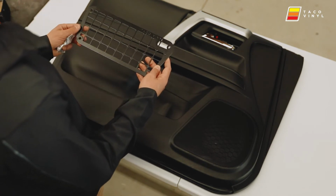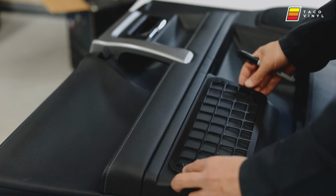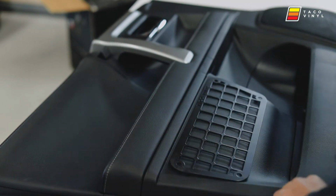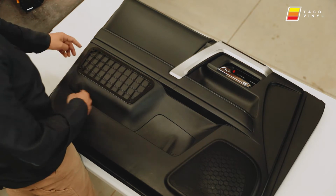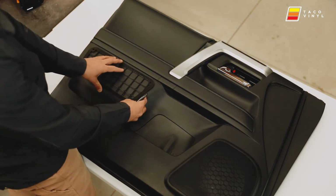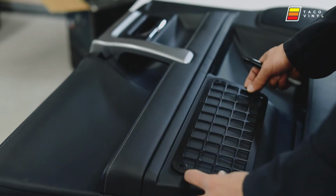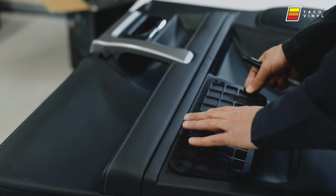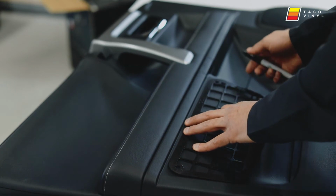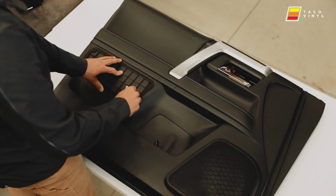and then drill them. Okay guys, now we got the Molle panel on the door. There's a line over here that you're gonna line up your Molle panel with, and also line it up with the top. I recommend leaving about 1/4 inch on the top, lining it up over here on the left. And then once you have that position good, get your marker and make your holes,